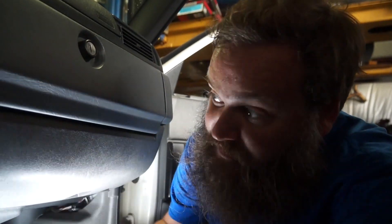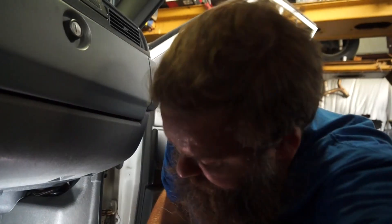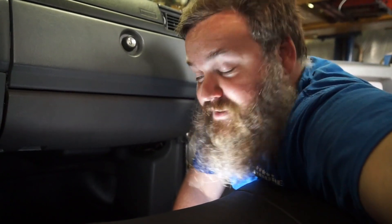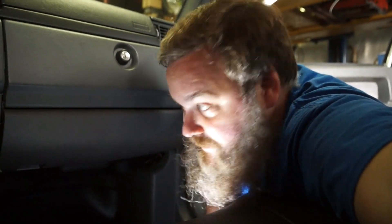Now that we've got our shroud off from inside the glove box, we're going to move to underneath, which is the knee panel. This has to come off — otherwise you have no access to where you need to be. In order to get that off, you have two 10-millimeter bolts, one here and one right here. You've also got a couple of little screw tabs. One thing you'll probably notice from a car this old: somebody's usually already been here and done this before, so you will oftentimes find stripped head bolts or stripped issues. These were supposed to be T15s — they weren't. These are 10 millimeters underneath this. Hopefully they are on yours as well.